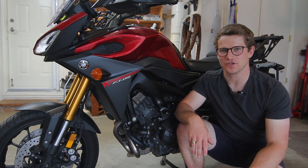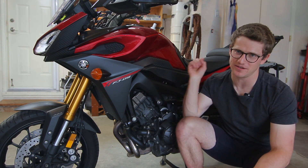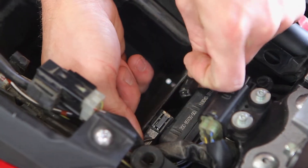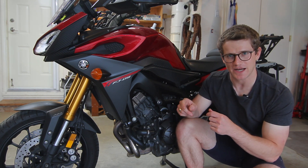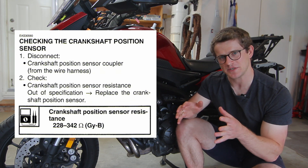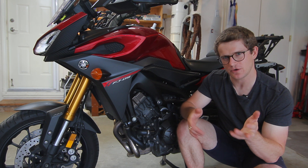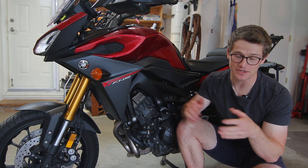If all that checks out, the next thing to check is your crankshaft position sensor — I've also done a video on this, linked in the description. The crankshaft position sensor wire harness coupler can be found between the battery and the ABS module. It's a two-wire connector with a black and gray wire. Once you pull it out, you want a spec between 228 and 342 ohms. Measure this at room temperature, around 20 degrees Celsius, because temperature affects resistance — don't measure it when the bike's hot. A bad crankshaft position sensor will also usually throw code 12, so keep an eye out for that.